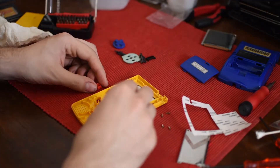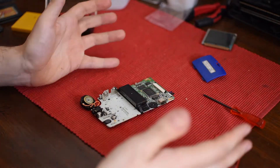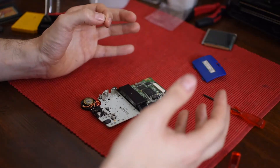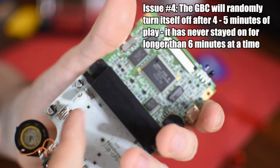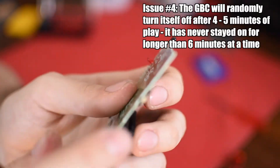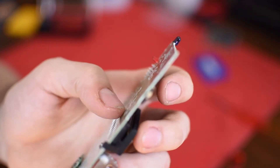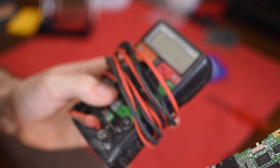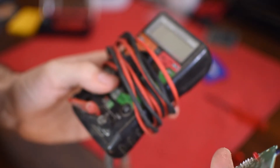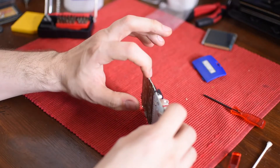I'm going to pop the buttons and pads back in so everything is good to go. Now that we've done the two easier fixes, it's time for the two larger issues — the broken speaker and the turning on and off. For the shutoff issue, I did clean out a lot of gunk from the battery connectors. I also noticed that the on-off switch itself is extremely dirty on the inside, so it's possible it's catching on something and causing this problem. Having done a quick examination of the board, there are no obvious broken components, so I'm just going to clean out that on-off switch with some isopropyl. This was actually really hard to move before, and now it's sliding super easily after that cleaning — so that's a good sign.